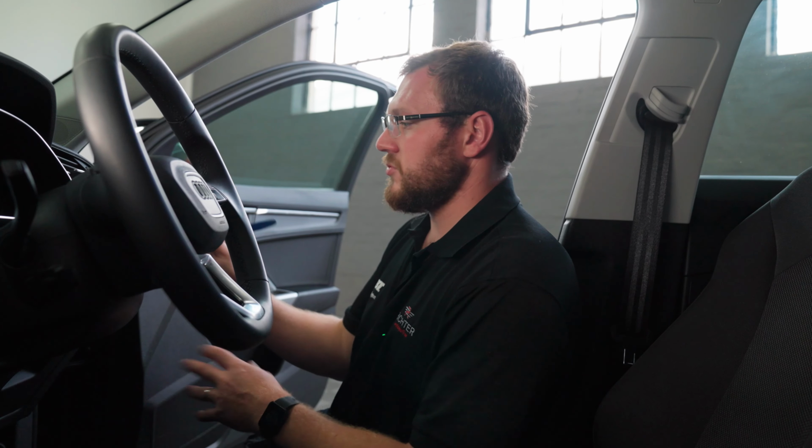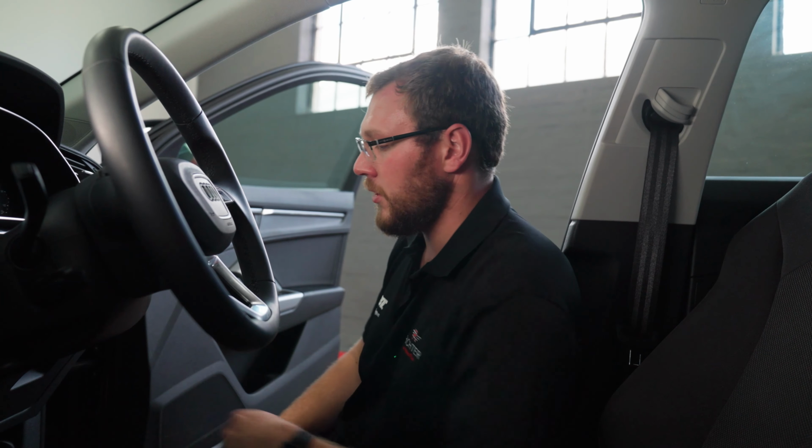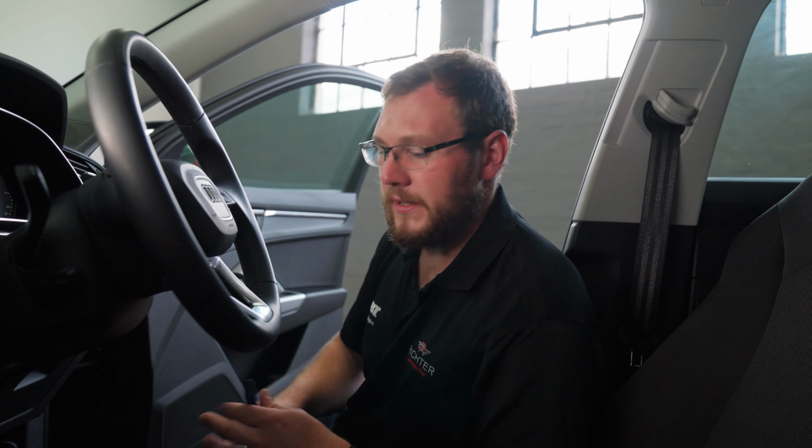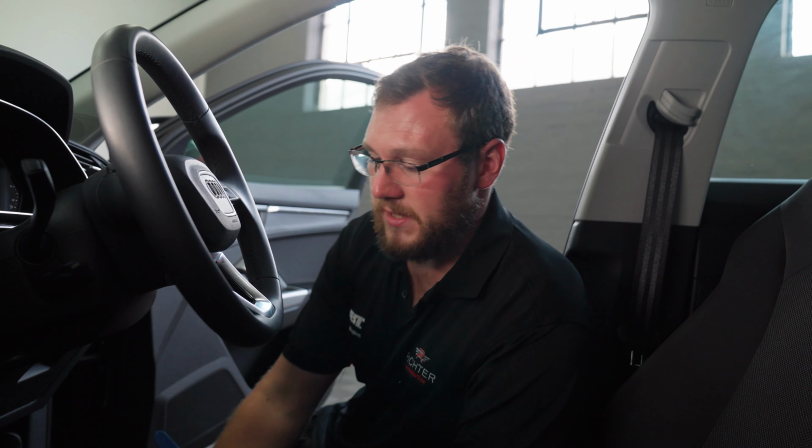So now we've got the front bumper and the scuttle panel back on. We're now getting into the car. This is where now we're going to strip the end panel of the dash and all the driver's lower column of the dashboard. Behind here is where we'll find the original rear parking module, but we're going to be fitting the front one now and then plugging our wires in.